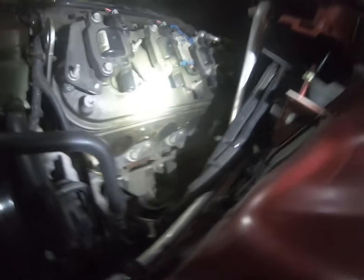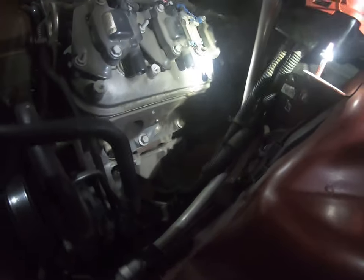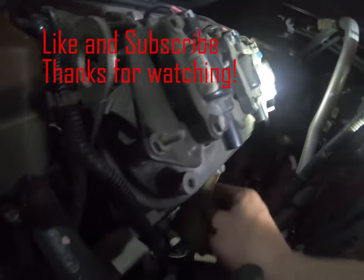The next thing I want to do is just clean the block or the head. Just going to use a light sandpaper, very light because it's aluminum. Don't want to scrape it all up or put any dents in it. But there are small little rust spots. I mean, it's not bad, it's really not too bad at all. Just want to get a smooth finish to it so the gasket doesn't leak.